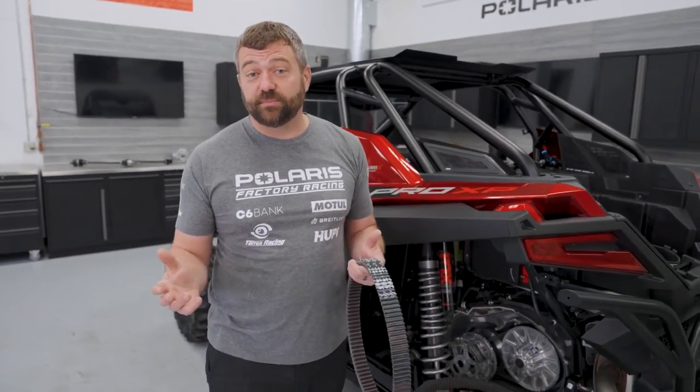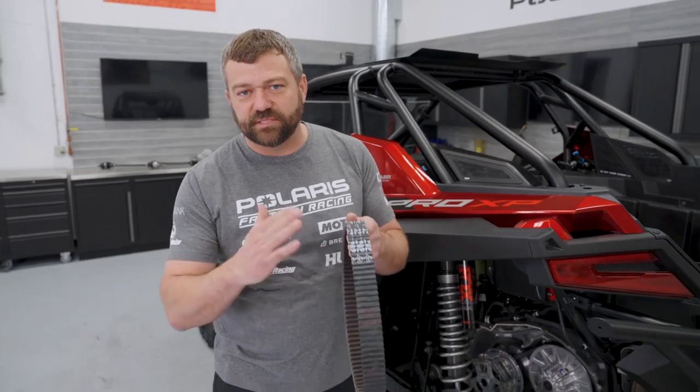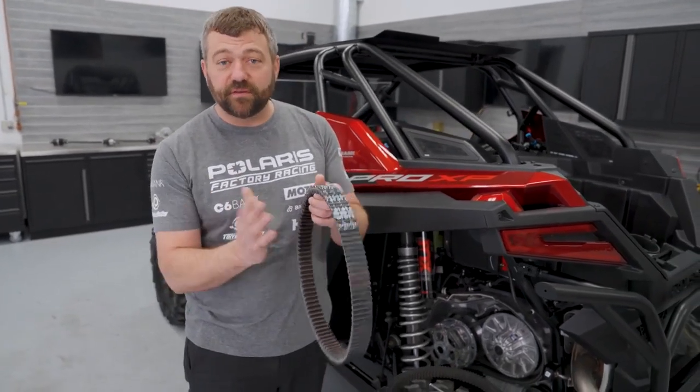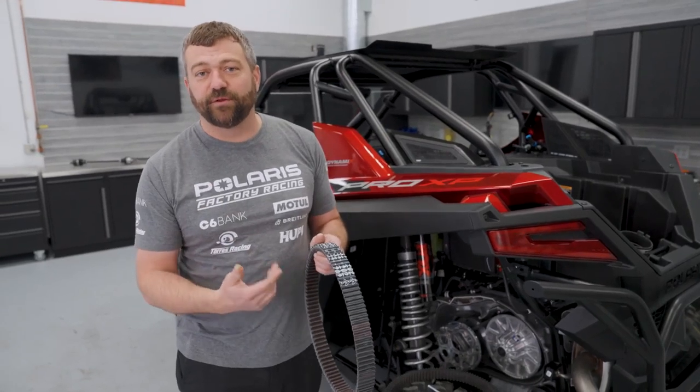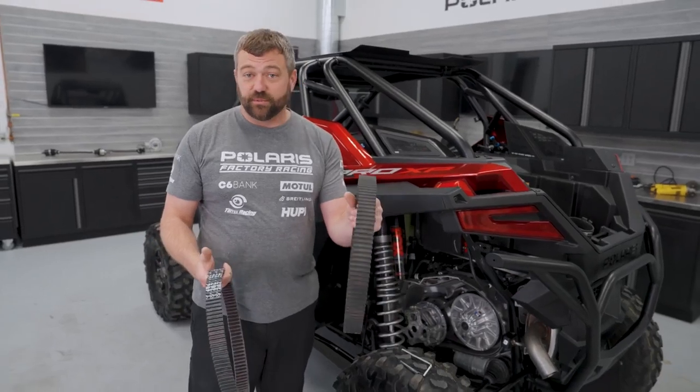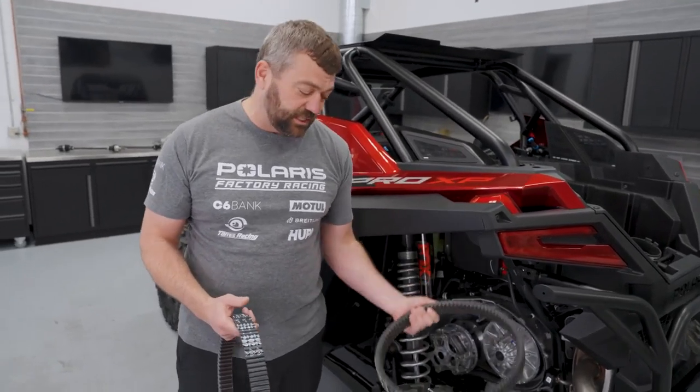If you're running in the dunes and you end up having to replace the belt, low gear is your best friend - stay in the little baby dunes. It's going to take you about five to ten miles, and be sure you run all-wheel drive when you're in those heavy loaded conditions like dunes, because if not you can actually damage your belt right away. The biggest thing that happens with a brand new belt is that you create a bit of extra heat because that belt is working to match those clutch sheaves. You want to get those perfectly matched before you put full power through the system.